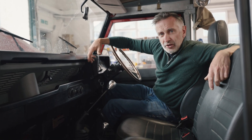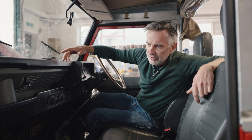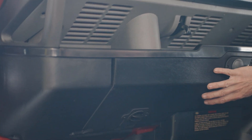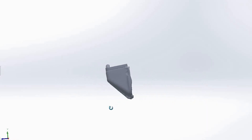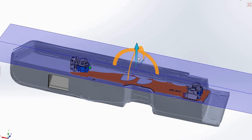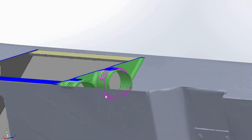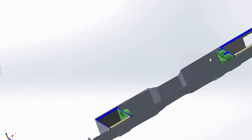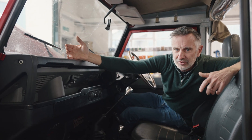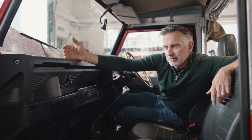Really, what you can't see is the important bit. Usually in a Land Rover like this, air comes into the lower section of the dash and fills the whole area. The main issue with AC is that if you put cold air in here, you get a lot of condensation forming on this panel. This is also the main firewall for the engine bay, so it's being heated up by the engine. Blowing cold air onto hot surfaces produces condensation, so the main task was figuring out how to get around this problem.